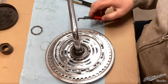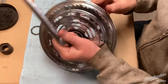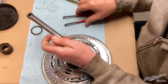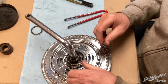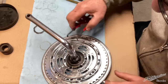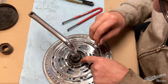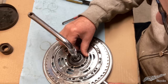You want to be able to tighten this as tight as you can so that you don't have — you're going to always have a little bit of end play there in order to get that freewheel action, but it's got to be minimal. Also unlike an axle where you have the cone go down and touch the bearings and then you back it off a little bit, holding that down with one cone wrench while you tighten the lock ring with the other, you can't do that on this system because these holes that this tool slides into are going to be hidden by this lock ring. So you need to tighten that all the way down and then put this cover lock ring on top of that.